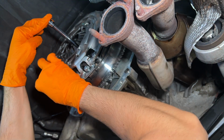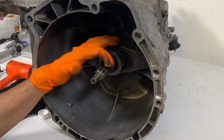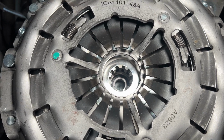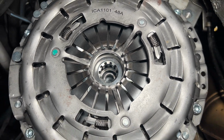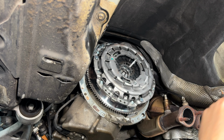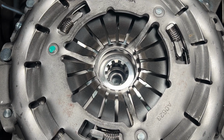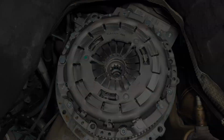The work you do with the clutch alignment tool will be most important, as you'll need to push the trans input shaft through the clutch and into the pilot bearing. If the alignment of the clutch and pilot bearing are off by more than a few millimeters, the input shaft from your transmission will not go in, and you'll be stuck half-inch away from your block, frustrated because you're so close but so far. So, make sure to check your clutch and pilot bearing alignment after pulling out your handmade tool. If they look slightly off-center, loosen your pressure plate until the clutch inside can be moved ever so slightly and line it up. Retorque your plate and then go for installing the transmission.